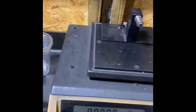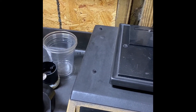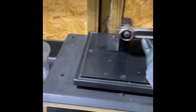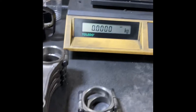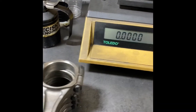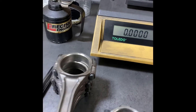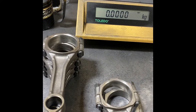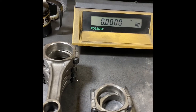198. And 197. So that's good — we're consistent. Everything is weight matched: the small end and the big ends matched. The pistons were good out of the box, the ring set, the pins, and the bearings. So now we can calculate our bob weight card.